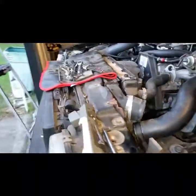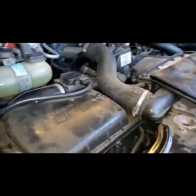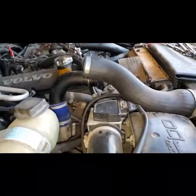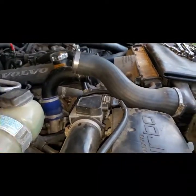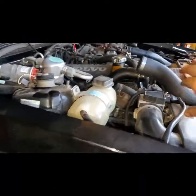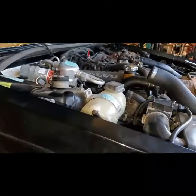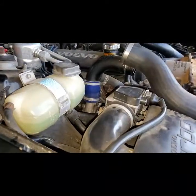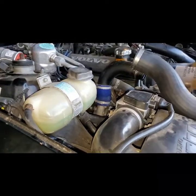With it being brought further forward, I was able to get past the little radius thing that covers up the starter gear on the bell housing, and I was actually able to get the transmission on. It took me a few hours this morning, but I got it. It took a lot of work, but I'm hoping this video will help somebody out working on one of these cars — like, hey, I can't get the transmission to go back in. Check your motor mounts. Make sure your motor mounts are not sagging. Because having your engine far enough forward to clear that little radius deal on the bell housing that covers the starter gear is of the utmost importance. If it's not far enough forward, that area of the bell housing will hit the transmission tunnel. There's no way around it — trust me, I tried.